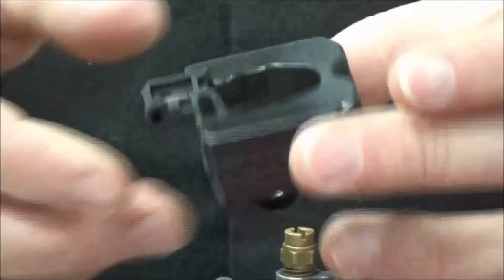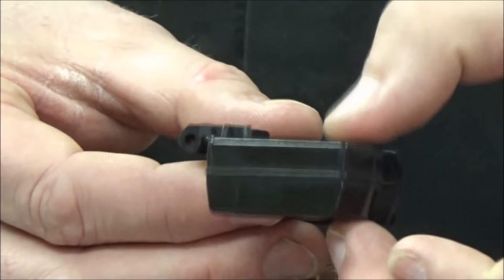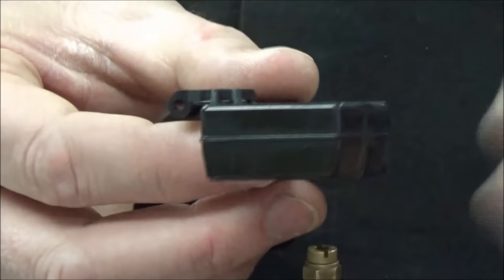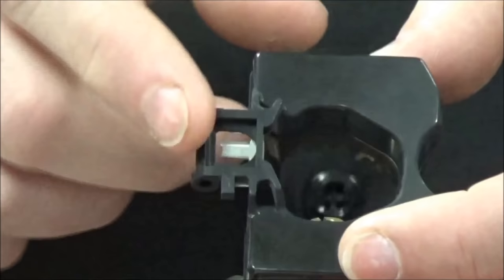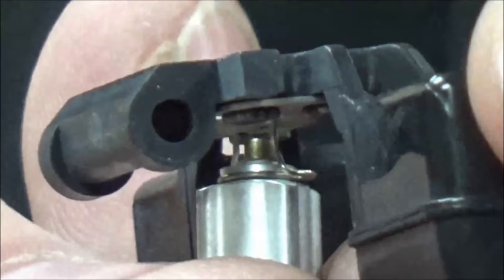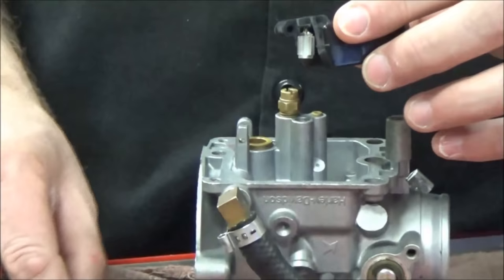Looking at our float here with this Harley design — it's plastic, it's one piece. I can't bend it or twist it. These lasted a really long time; they didn't rot out or get holes from being soldered together. But we still have an adjustable float — see the metal tab in there. I'm going to demonstrate adjusting it, and we'll make a video just on float height. We take it and put this little clip around here so the float just sits on there — watch it push in and out.